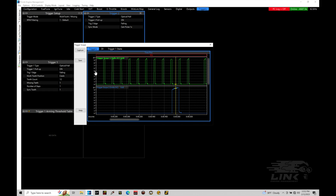The next thing is checking our trigger type - do we have the correct trigger type selected for the sensor we're working with? Remember, if you see a two-wire sensor that's generally going to be a reluctor sensor; if it's three-wire, it's usually optical hall. My sensors are three-wire and I know they're optical hall. Looking at the waveform, we're looking for a square wave type of signal. What we're finding here is it goes pulses on, pulses on all throughout - a clean square wave pattern. This verifies that optical hall is correct for both trigger one and trigger two, because we do not see a sinusoidal type of waveform output as we'd find with a reluctor type sensor.